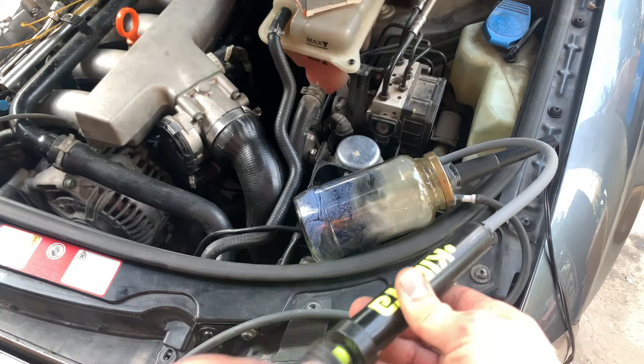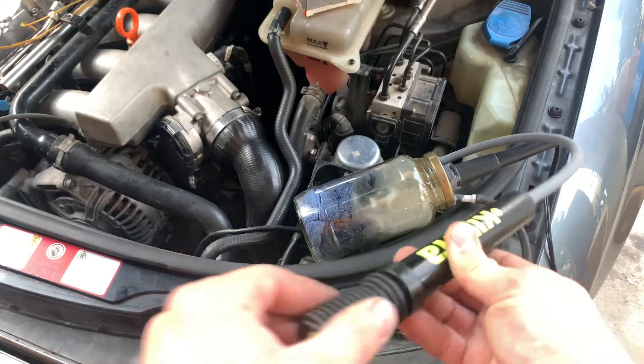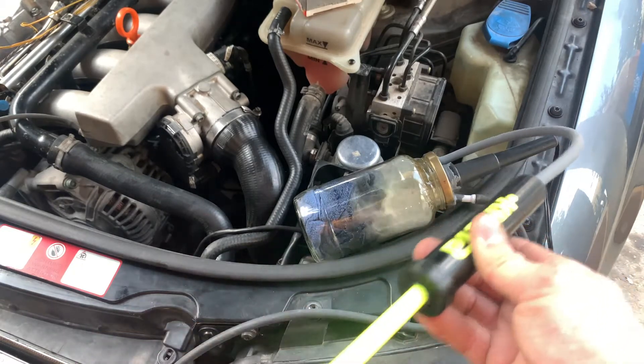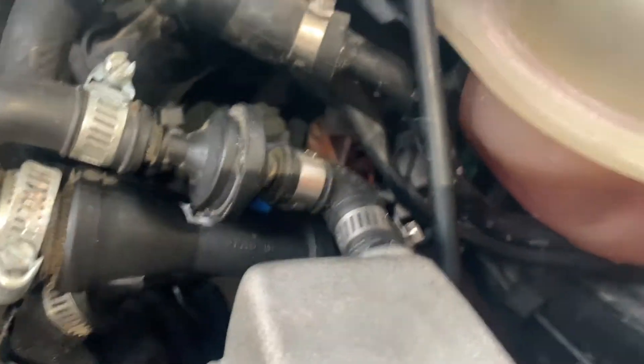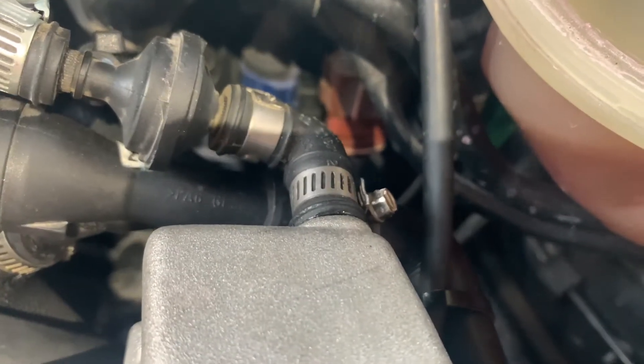You can see it's swirling like that — we know the system is going to start filling up with smoke. So that's kind of what we're doing, and we'll see if there's any leaks. If you look — I don't know if you'll be able to see that — the camera, you can see there's a little smoke leak right here. A little vacuum leak. That's where we're seeing smoke.